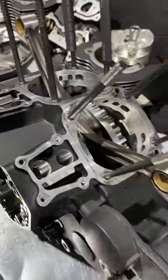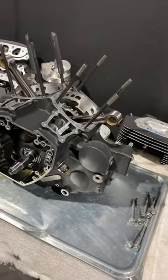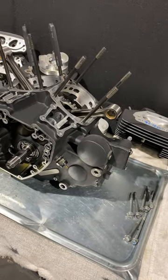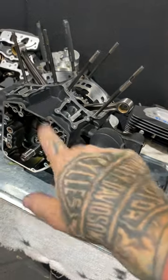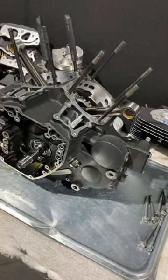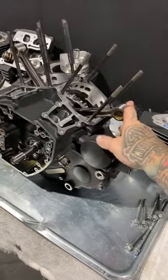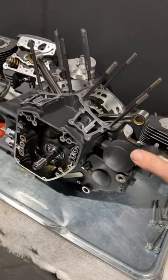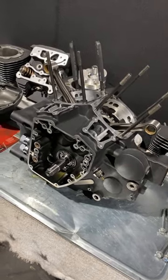So we're going to pull the crank out. The crank pin has been welded. The hard thing is with S&S, the crank pin has got a spread on it where it really bites in and has really, really good clamping allowance when it's press fitted. It's had the crank pin welded, but we're going to unpick that and try and get this apart — fingers crossed we can. This apparently came from a reputable crankshaft rebuilder.